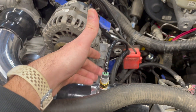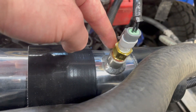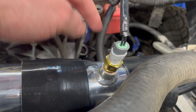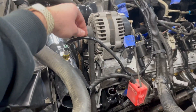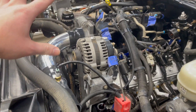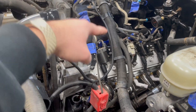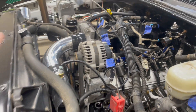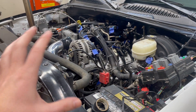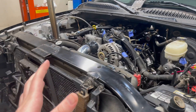Here's the Delphi intake air temp sensor. You can see my Huron Speed cold side intercooler piping came with a bung welded for this, because a lot of people convert their trucks to speed density. Here's the wiring I split out of the mass airflow sensor harness — I ran it along the main truck harness and then brought it up and over. It looks pretty clean. It does look a little bit out of place, but if you're not really looking for it, you're not going to notice it. This is how I would recommend doing it.